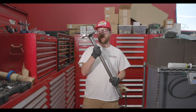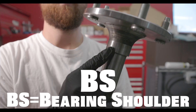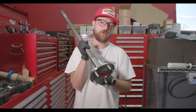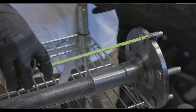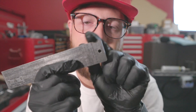Here is another bolt-in axle, but this time without a wheel bearing. When you don't have a wheel bearing, you can measure to the shoulder. The shoulder for your wheel bearing is a different position than your B.E. When you measure your B.E., it's not the same as your B.S. — they are different, mostly because the inner race and outer race of your wheel bearings are not the same widths. When measuring this dimension, be sure to use a straight edge. You're measuring from the outside face to this hard stop — hook your tape here, pull back, then use a straight edge to come up to your tape. For the bearing shoulder, I like to use a radius edge straight edge; it fits in the pocket of that shoulder and ensures you're not getting cheated by a sharp corner pushing out from that radius.